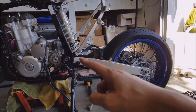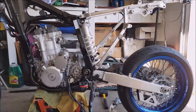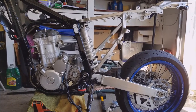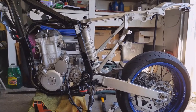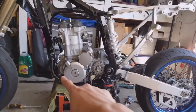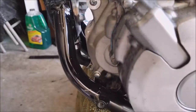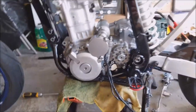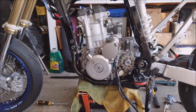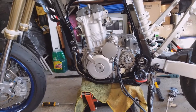I got new rear sprockets, and you can see I have a new chain on there too. My next challenge is the electrical — I hopefully have everything mapped out and I do have some references. I took a lot of pictures. Also the oil hoses — there is this hose here that has a screen filter that everyone says to remove and clean out, so I'm gonna do that before I put new oil in.